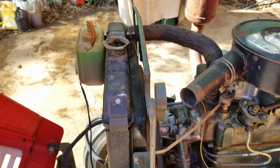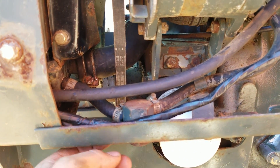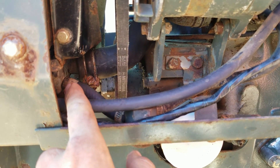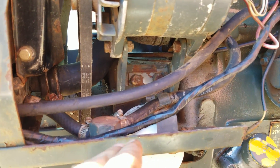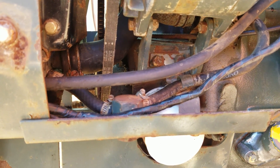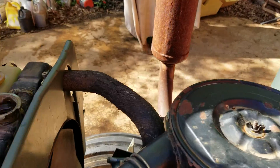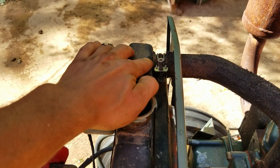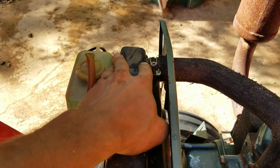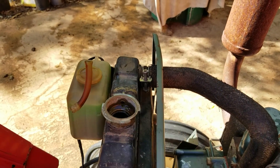So I'm flushing this thing out. It's got this nifty little drain at the bottom of the radiator — it drains out right here and then it drains the block up there with a bunch of little hoses. I already pressure tested it — it was leaking right here. That makes sense why it was only halfway full, because I sprayed bubbly soapy water on it and it was bubbling up. I got that tightened up and pushed the hose on more, so it's not leaking anymore.